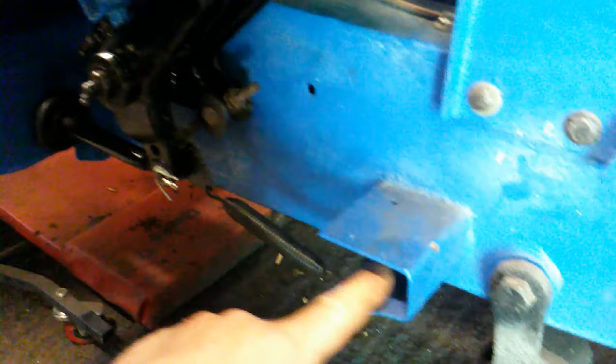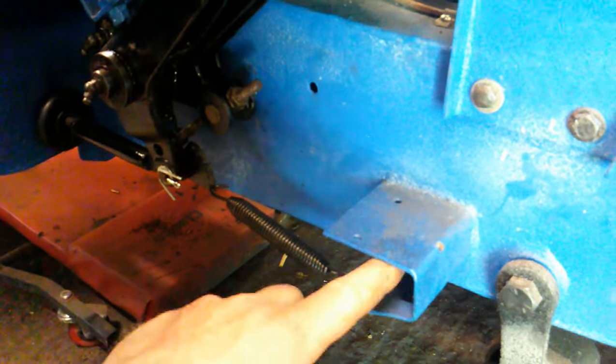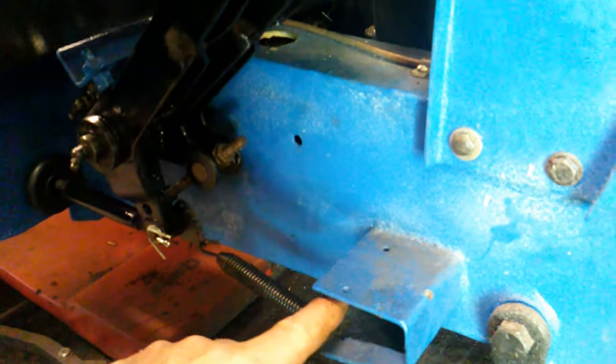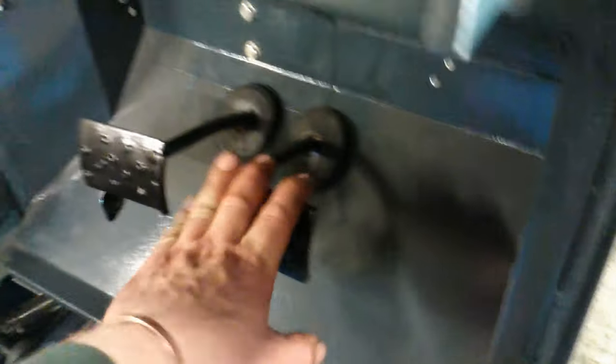As we saw last time, brakes are all done, put a new spring on. The brake pedal switch goes in here, operated by a little spring. It's a brilliant little switch — literally just a contact switch as it pulls. Brakes all good now. We have a brake pedal, we have a clutch, an operating clutch. So I put the coil on up there, bolted that on, cleaned that up.